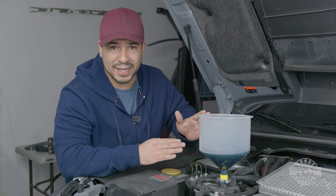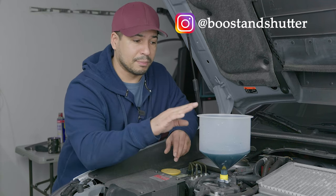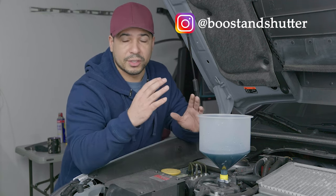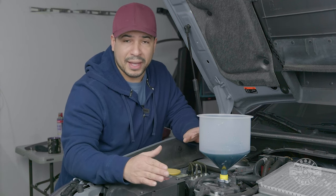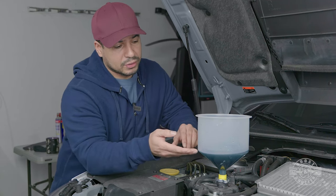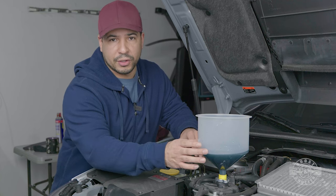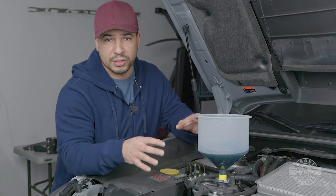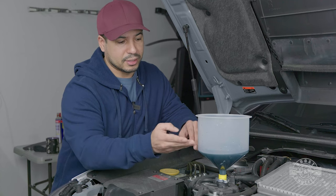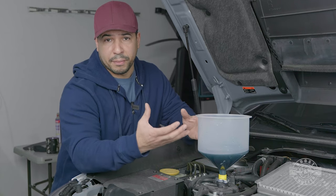I'm going to turn on the car, put the heat on max, and allow the car to come to temperature and just watch the bubbles come up in this container. As the bubbles come up, the air they used to occupy inside the engine gets replaced with fluid, ensuring the system is filled to capacity with absolutely no air. When the car is no longer taking in coolant, only fill the coolant up to about a third of the bucket. Depending on which part of the cooling cycle the car is on, fluid can come up or down — if it's too full you could overflow it, and if it drops below the fill cap, add more coolant until the burping is done.